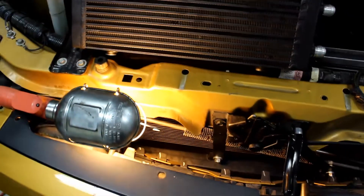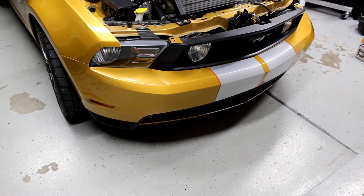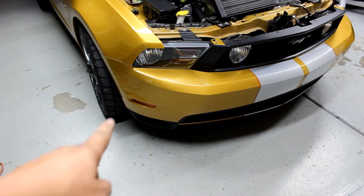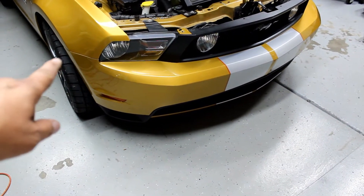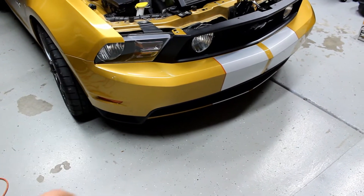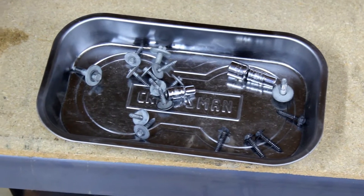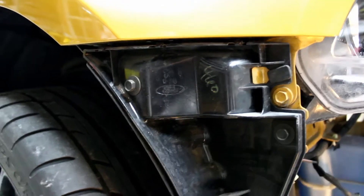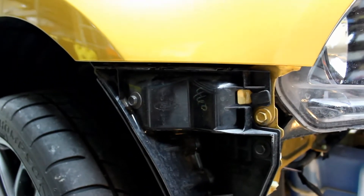The plan is to put the oil cooler right behind the intercooler braces so I can use the bolt holes, make a little bracket, and have the bottom two nuts screw into those two bolt holes. We need to jack the car up, take off the plastic under-piece, and unbolt the corner of the bumper — one there and one in the middle on both sides. Then unpop the seam by pulling on both sides. The silver ones are on the bottom, the black ones are in the wheel well — only two on each side. Pull the clips and pop out the bumper.